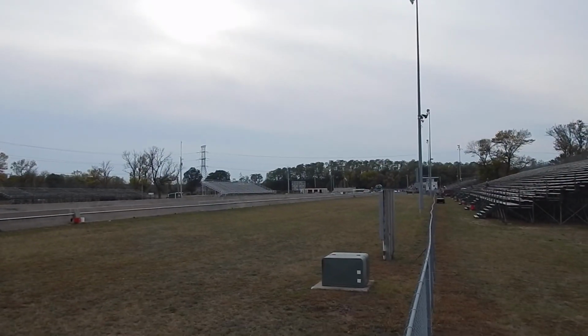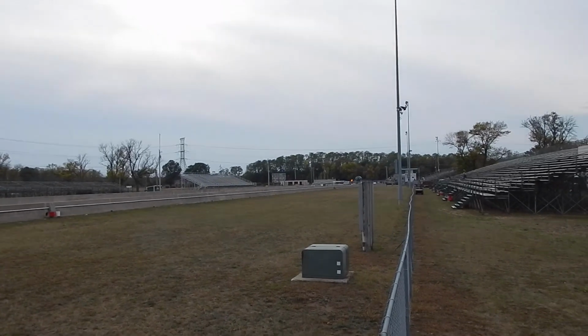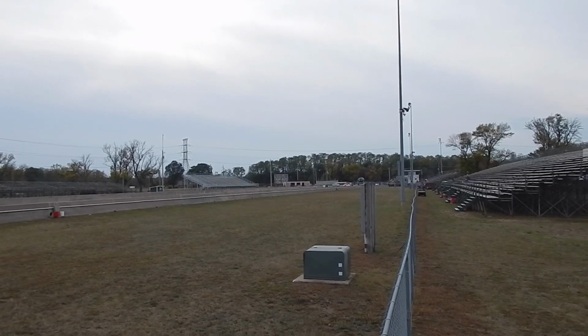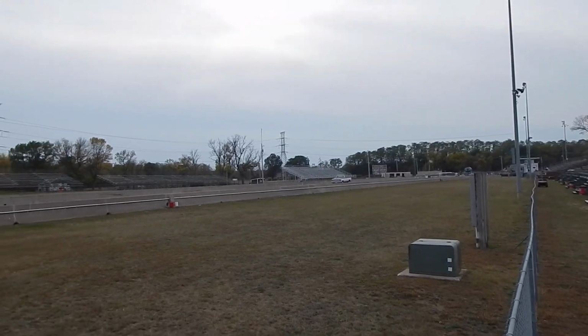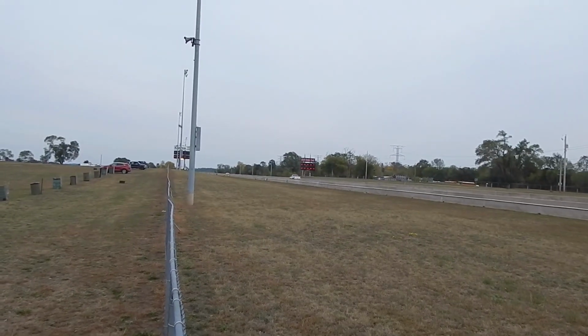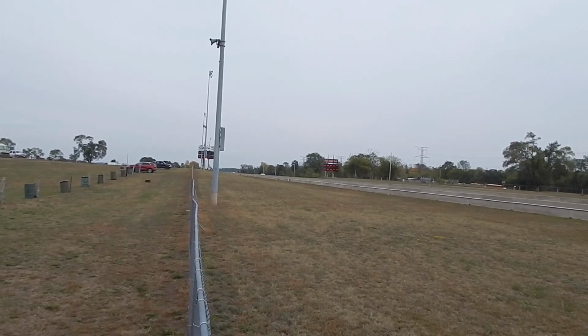So we did get another run, but I went out there and this time it basically cut out and died. In fact, I thought it died, so I let up on the gas and I was going to restart it. But when I let up on the gas, it closed the butterflies, allowing it to pick right back up, and so then I just finished out the course and then got off the track. So it was a bogging pass, guys. There's nothing else I could do.